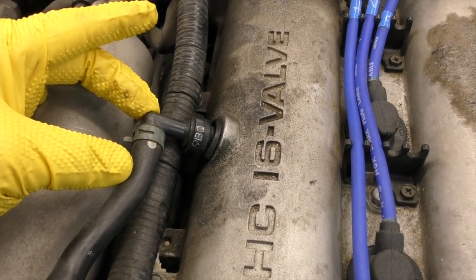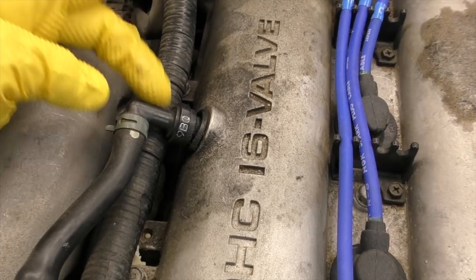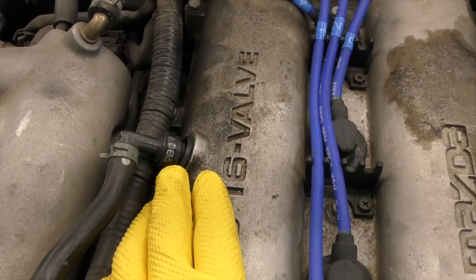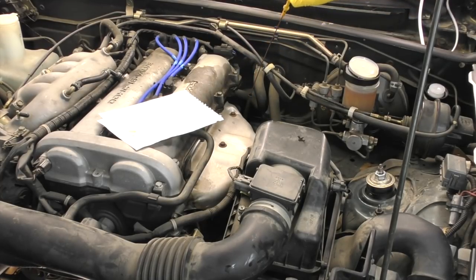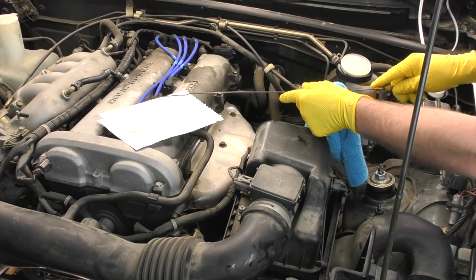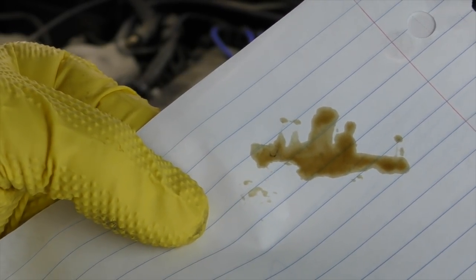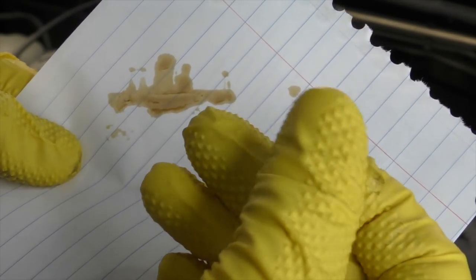As we make our way back to the engine oil dipstick, we have our PCV valve right here. I'd probably recommend replacing this on a lot of cars, especially if it's this style — these are only a couple of bucks and super easy to replace. We'll do the PCV valve when we do our oil leak repair. Kind of like we did with the power steering fluid, we'll pull the dipstick, check the level — which looks kind of overfilled — and run it on a clean piece of paper. If you have anything crusty or sparkly in the oil, we may have bigger issues. This looks pretty normal.